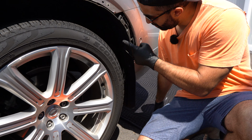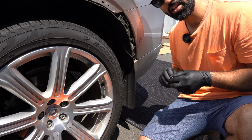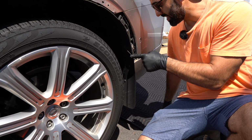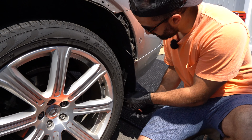Next we're going to remove 1, 2, 3, 4, 5 trim screws using a T25 Torx bit. If you have mud flaps, the procedure is pretty much the same. In my case, I actually made these mud flaps myself and I sell them on the side, so I'm going to link everything in the description.